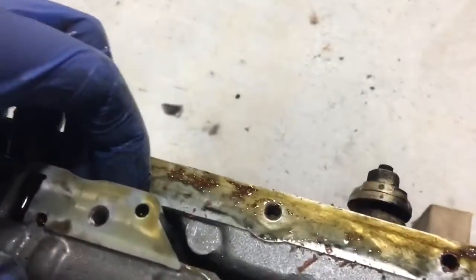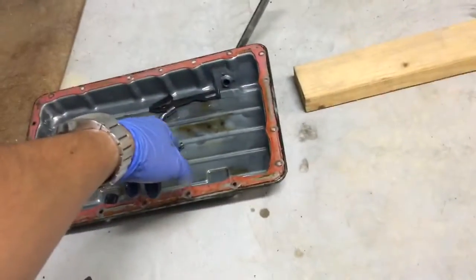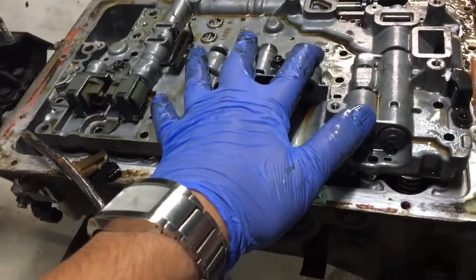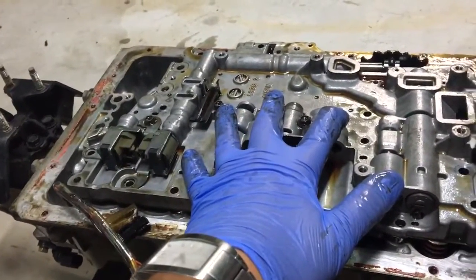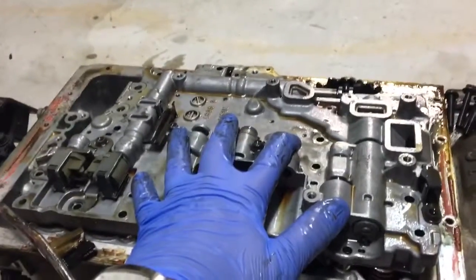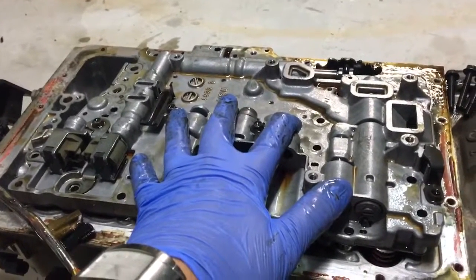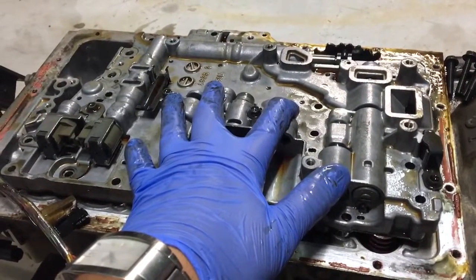I don't actually think it retained anything that went down into the bottom, so it probably could have stayed on, but I took it off because it's probably going to get damaged in transit anyway — it's only thin steel. I'm sending this to a transmission shop to have the valve body modified so it'll shift quicker, faster, more efficient. That's obviously what you want when you're upping the boost and getting more power. It'll help preserve the gearbox as well, because you don't want it flaring mid-change when you've got four or five hundred horsepower. Hopefully this will go back together the same way it came apart.